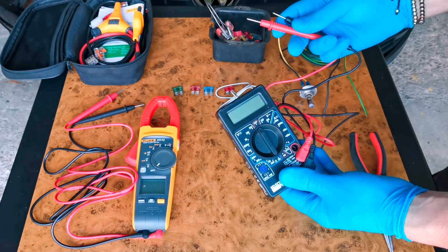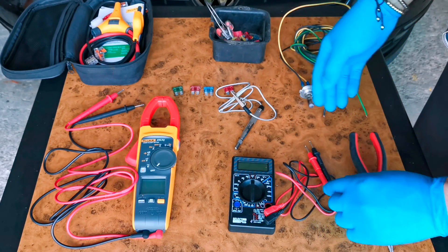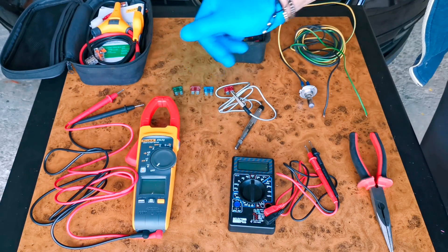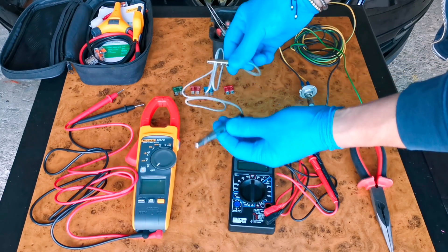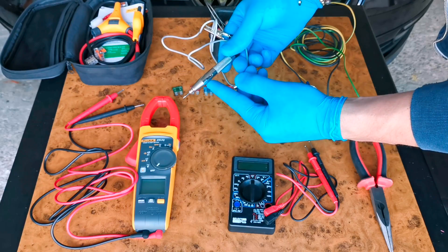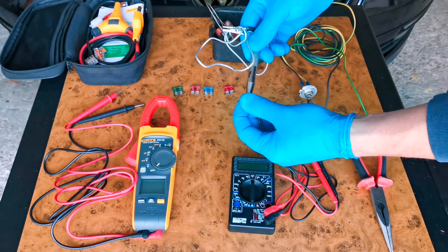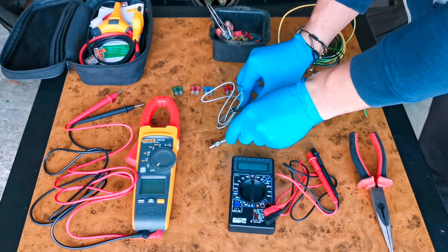I have here an old multimeter. As you can see this is a multimeter but it's a new model. But it's doing the same thing as the old one. And the method number two is to check them using a tool like this. You just have to put it to the ground and after that put it on the fuse. A light will turn on if the fuse is good, and if the fuse is burnt the light will not turn on.